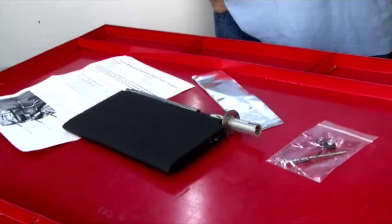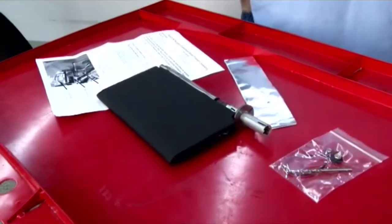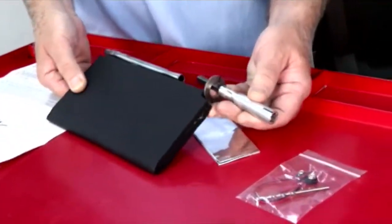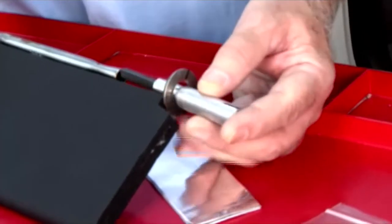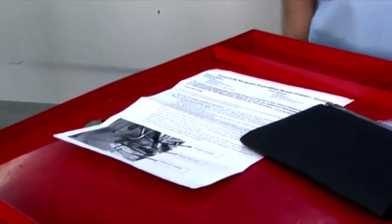You know, a lot of guys, you're out there, you're towing your cars to the track, you're towing your boats, you're using your truck to run around town and pick up stuff or whatever. So this gentleman here that has this particular F-150, well, he's got the problem. F-150 does have a very common problem with this failure, and the components that we make are made in two parts so that the door can be installed, and then the axle that connects to the motor come in from the end, and we have complete written instructions with photos and videos online. So it's a relatively easy fix for a very expensive problem, and something that's very annoying when you don't have heat and AC.